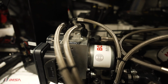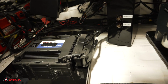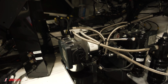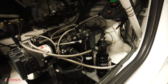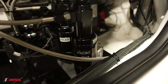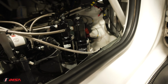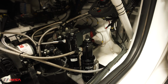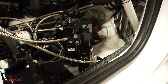And there's another component here. It's called the brake feel simulator. Effectively, with the electric system, I'm not pushing a hydraulic pedal, so I'm not getting that hydraulic feel like you normally would. So there's a front and rear, like a black tube there. And that's, for lack of a better word, two springs that give me the feel of what I want. If you think about your simulators at home or DIL, driver-in-loop simulators for GTP cars, it's basically the exact same thing, but just here in reality.